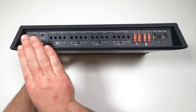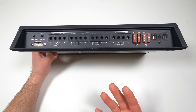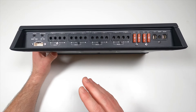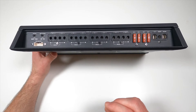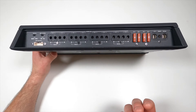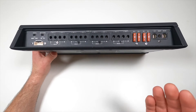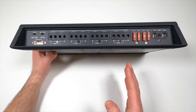In terms of inputs, I'm using a front and rear setup — four RCA channels: front left and right, and rear left and right. The front left and right will be driving the signal for the tweeters, mids, and woofers. Then the rear inputs are going to drive the rears. This particular truck originally had a four-channel setup, so that's why there's only front and rears.